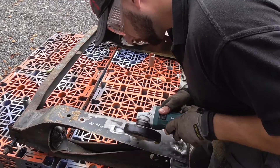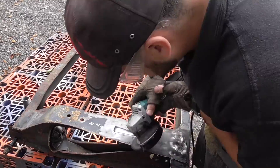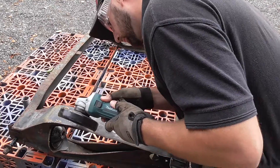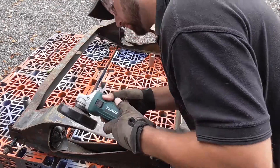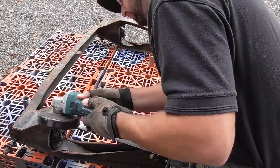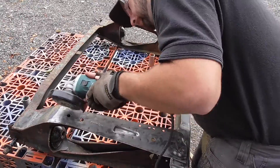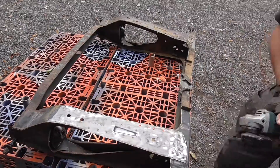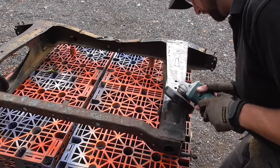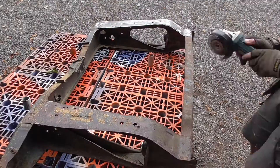So in the interest of keeping things moving it's time to get on and do it myself. I do have a total loss sand blaster at the workshop, however the setup time and ultimate mess created puts me off using it. So instead, as these subframes are in fantastic solid condition, my plan is to strip them back to bare metal using a wire wheel, then coat them with a chemical agent to deter rust, and once that's dry I'll etch prime the frames ahead of laying down several coats of stone chip. Admittedly this won't give me the smooth gloss look I originally wanted, but it will protect the subframes and keep them in great condition for years to come. A solid, protected and future proof mini. This car will never enter a concourse show so I think the stone chip finish will do the job just fine.